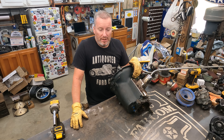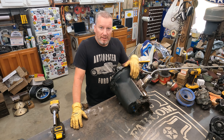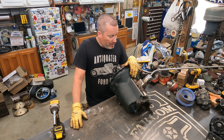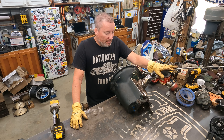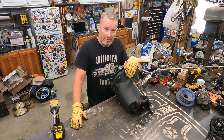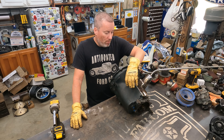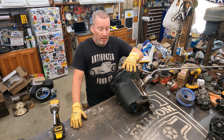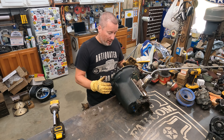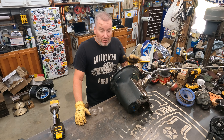I was going to take a rebuilt side-shift that I bought at a swap meet and transferred into a top loader case, but I decided that if I got into that transmission and it wasn't rebuilt and I needed parts, that was going to slow me down. This one I know is a good trans — it was rebuilt when I bought it, I had it in the coupe, ran perfect. When I took it to the drag strip, we popped the cluster, knocked some teeth off. So my plan is to take it apart, swap out the lower cluster gear, put everything back together. This should be the easiest solution since I only have eight days.